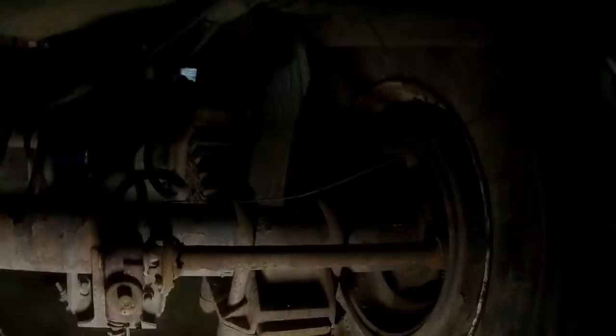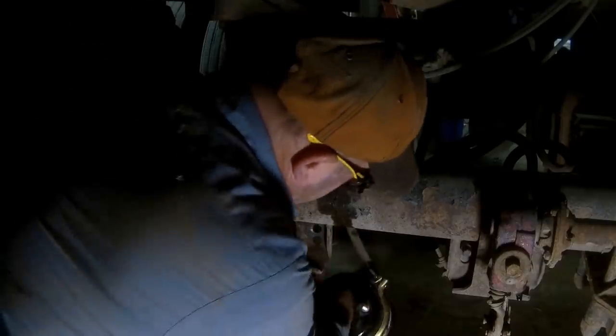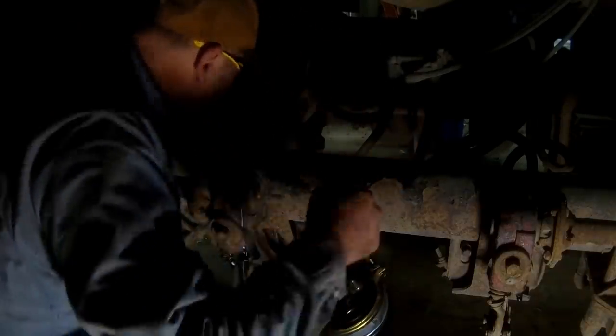Okay, these brake chambers can be rather dangerous if you don't know what you're doing with them. These ports here happen to be in the position that I need them to be in. You can set these guys up here. You can adjust this chamber. You can turn it, but you need to cage it. I'm gonna end up running this guy through the back like this.